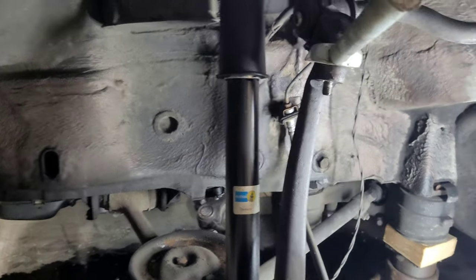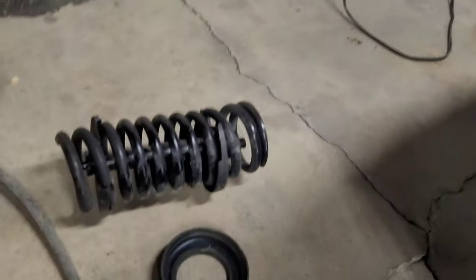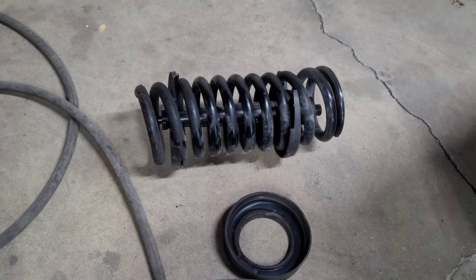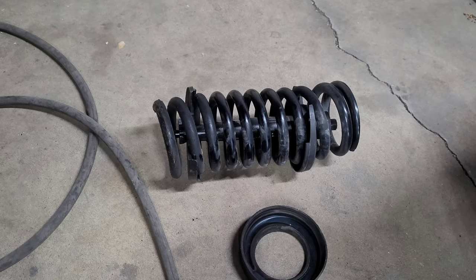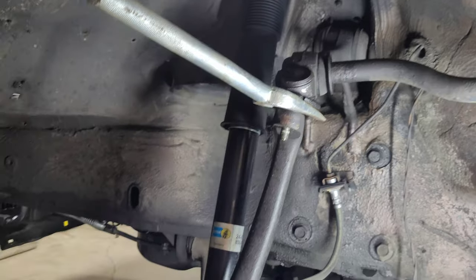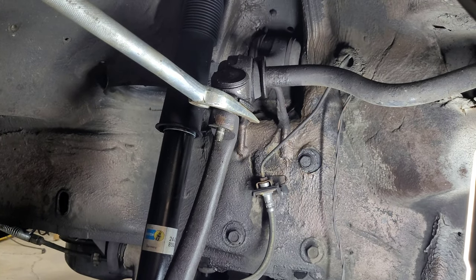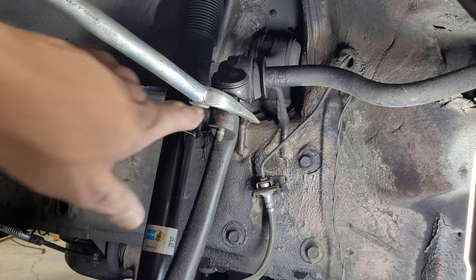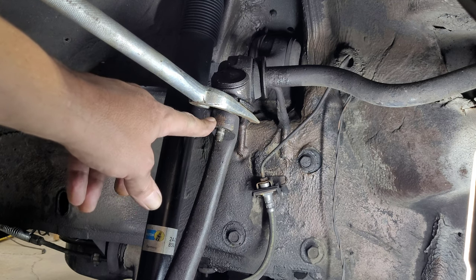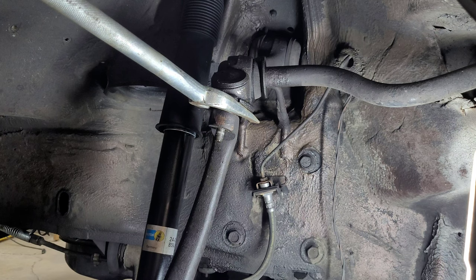As you can see, I've got the spring out of it — it's super easy to do with that compressor. I'll show you a little bit about how to get that thing in there and get it to operate right. But for now I'm going to get in here and get this upper ball joint taken out. I've got this pickle fork here; hopefully I can get that ball joint knocked out of there.